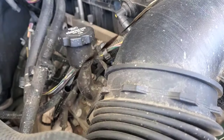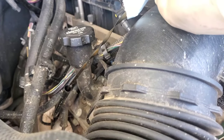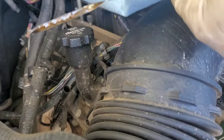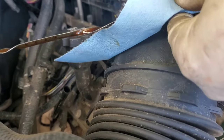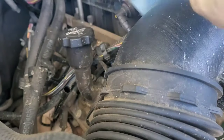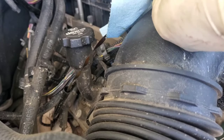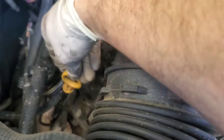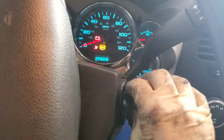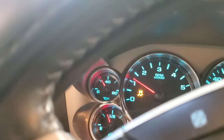We did lose some oil, so we're going to go ahead and check the oil level. I think total I lost about 10 ounces — that's less than a soda pop, so I'm not too worried. But we did lose some oil, so it's the right thing to check it. Oil is full — not going to have to add any. Just cram that big dipstick back down in there. Next is my favorite part — start the truck. It started, that's a good sign. Watch the oil pressure — want to make sure it builds up. And it does.